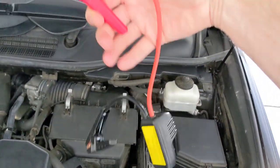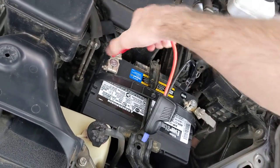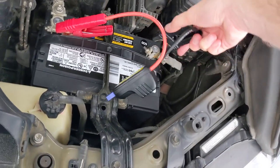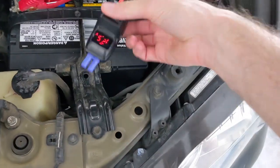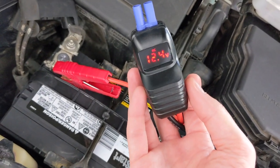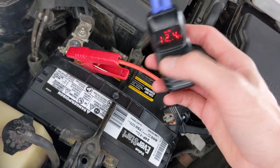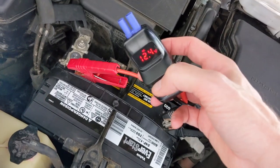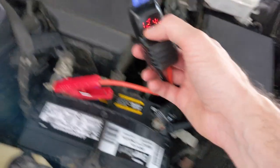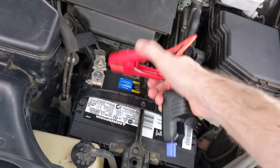The next thing we're going to do is test the battery without your actual battery backup — we're going to test this jump starter. There we go, plug this one here. We've got 12.4 volts, which is a good reading. This is a way you can check your battery to see if it's good or bad. It doesn't put a load on the battery so it's not a true indication, but if it falls below 12 volts and is in the low or mid 11s, you'd definitely struggle to start your car. It's a nice little battery tester feature.